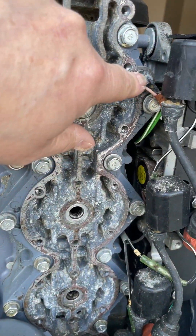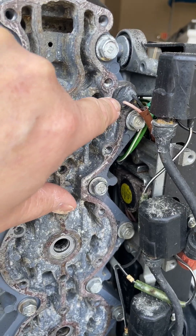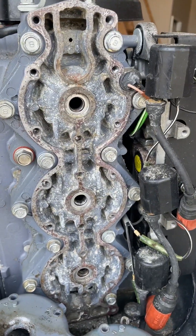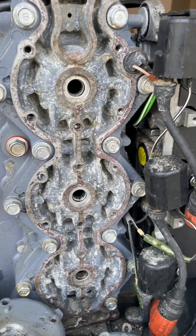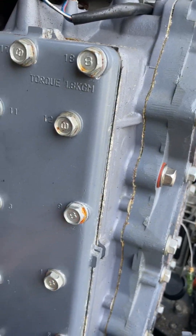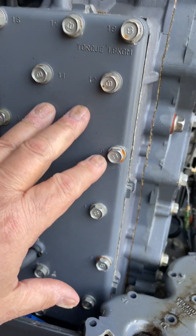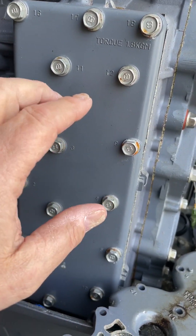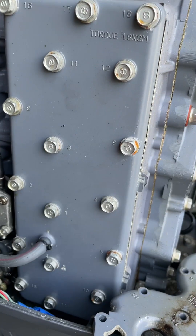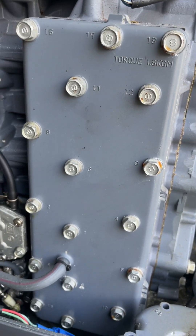Just for reference, this is the temperature sensor right here in the cylinder head. So at higher RPMs, the alarm would go off. Over here is where you flush the engine — the flushing port goes into here. I would not recommend that you do anything with this. These bolts are immersed in the water jacket, and I guarantee you if you try to take them off an old motor, you're going to break bolts.